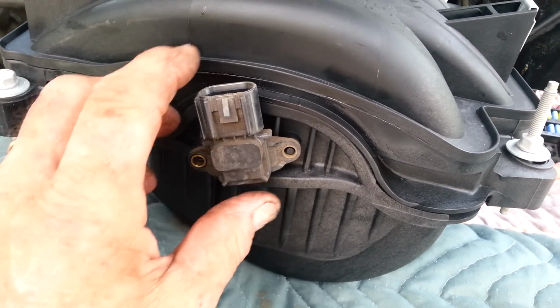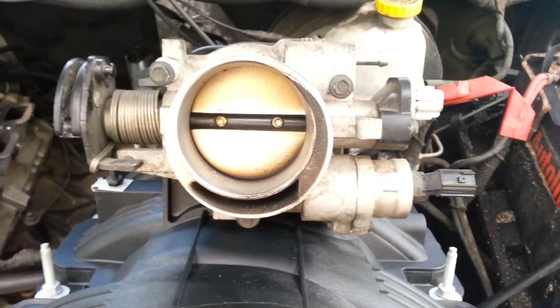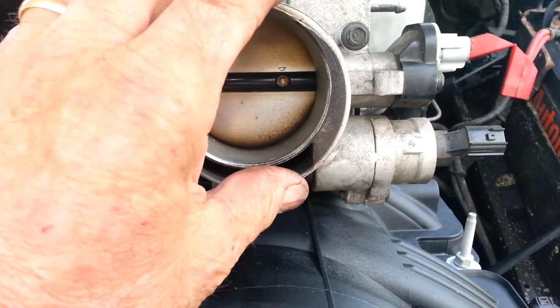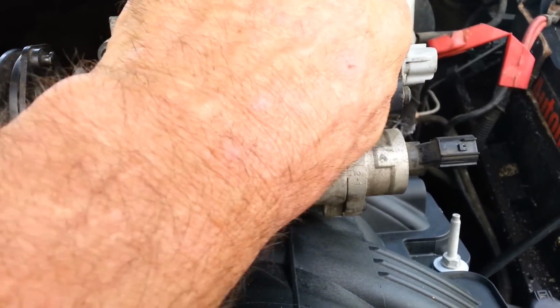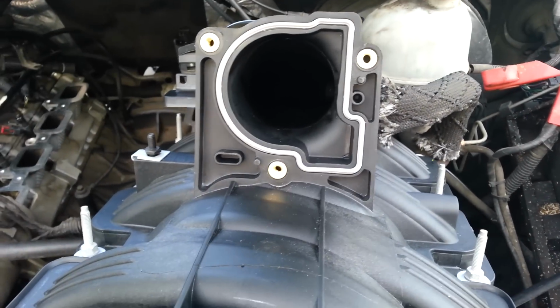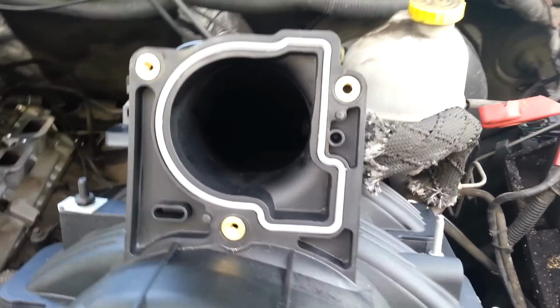That's just the Torx on one side. That sensor comes off. Your mass airflow, 2 bolts on top, 1 underneath you can get to once you take the rubber boot off. Get that out of your way. Take the cables off. Take the throttle cables off, and take off your 2 plugs here. Get it out of the way. It'll help when you go to lift it off. It kind of blocks it up here on the firewall.